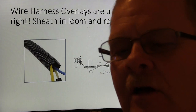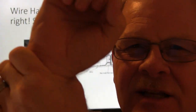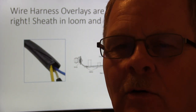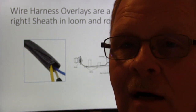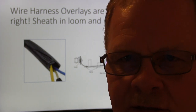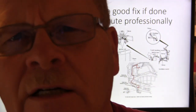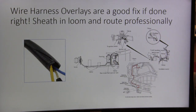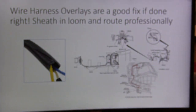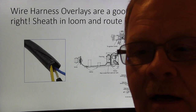Wire harness overlays are a good fix if done right. Rather than tracking down and splitting a harness as thick as your wrist to find one wire, if you know the wire only goes from point A to point B, you're better off just running a new wire. Pull it through a piece of loom, make sure you route it so it's not going to get caught on a drive belt, hit the exhaust, or anything like that, and make it look as factory as you can — because every job is a picture of the person who did it. Don't just throw it across the top of the engine unless it's temporary just to verify the fix.